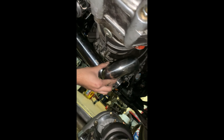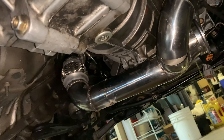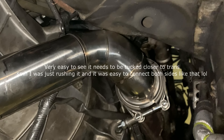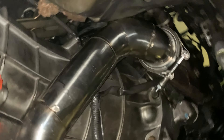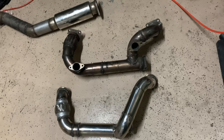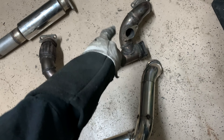Bank two is here, bank one is on this side. The V-band is going to point up this way — kind of going 45 one direction and then 45 the other, so you can see how it merges and loops up right here. Holding the pipe gives a better representation of how it heads up toward the header. I ran out of welding wire so I'll continue when I get more. Right now it's mocked at smaller than a 45, going into a 90 — that's basically how this side is going to go. I didn't get to film much of this; it was just trial and error fitting pieces.